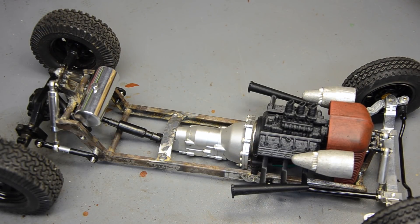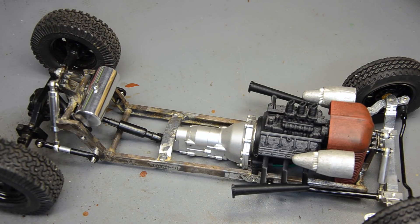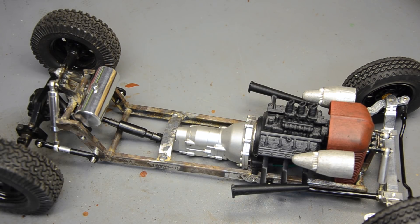I used an adapter plate from RC4WD and had to modify the mounts — they had already been modified for mounting in number three, which is the transmission I went ahead and stole from build three. I had to grind the aluminum down and weld those plates to the side of the frame. I marked it, made the pieces to fit, clamped the two pieces together, and drilled the holes so they're the exact same height. I got lucky — it came out perfect. For hardware, I don't have a sharp enough drill bit in the right size for the 3mm hardware, so I had to oversize everything and use washers. I drilled all the pilot holes with a 2mm bit, then had to go up to a 4mm just to get the hardware through. I really need to buy some new drill bits — all my others are burned up.